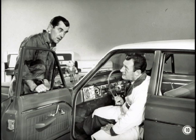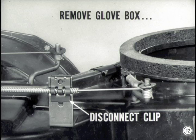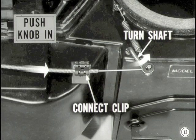What about adjusting the cable to the air door, Chet? Good question, Paul. It's a simple but important adjustment. If for any reason the cable's not adjusted properly, the air door could be held slightly open when it's supposed to be closed. This can cause a rather loud fluttering noise under certain conditions. To adjust the cable, first remove the glove box to get at the cable adjustment point. Disconnect the cable mounting clip on the heater housing, but leave the cable attached to the air door shaft. Be sure the control knob is pushed all the way in. Then turn the air door shaft counterclockwise as far as it will go and hold it there while you connect the cable mounting clip.